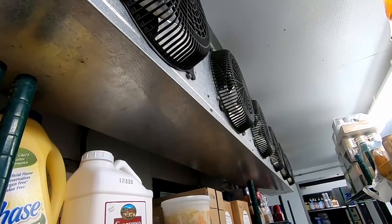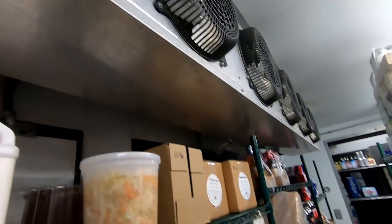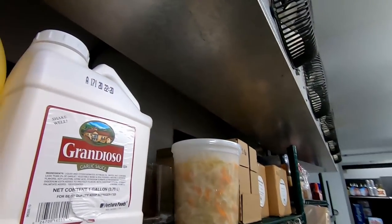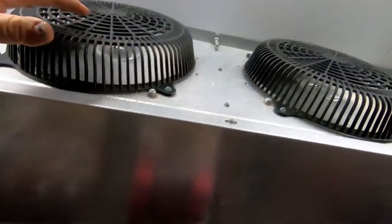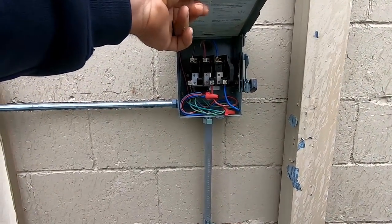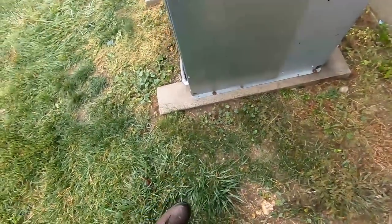We're going to turn it back on and go see if we can put it in defrost. This probably has heaters on it because it's in here with the beer cooler area — sometimes these have it because they run them a little cold. But that's frosted up to the point where it's almost ice. Let's take a peek in there — everything's non-fused. Let's get this thing open and see what we can find out.